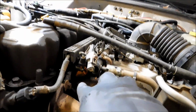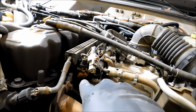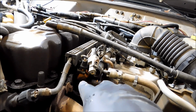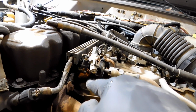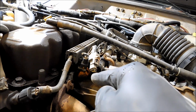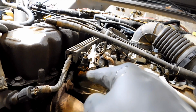These injectors actually aren't the Mustang ones. These are Ford Explorer E code. They came out of a 4-liter, but they're 19-pound, but they're a little bit more attuned for my 4-liter than what the 5.0 is. They still have the 4 holes in them compared to the factory injectors that have a single spray hole, so you get a lot better atomization with these ones and more consistent fuel spray across the intake runner.